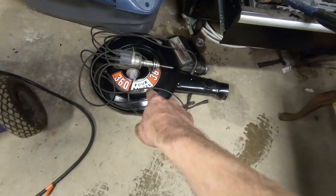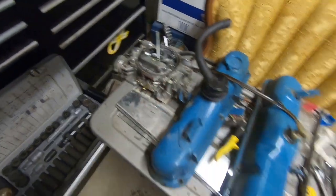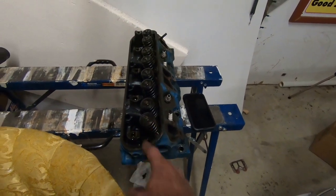Let's get you up to speed on where we are. We're at a little bit of a standstill and we're gonna have to regroup and come back to this. But let's recap: we started off by getting the air intake and distributor out of the way, then came the carburetor, then the valve covers, then the intake — and we've got one head done on the passenger side.